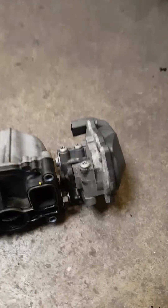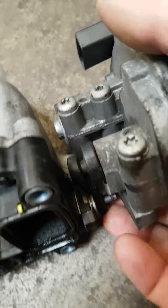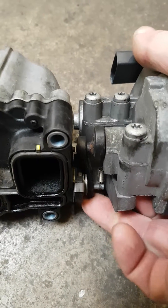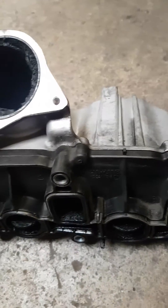First of all you've got to establish which one is causing the trouble. All I do is disconnect one and see if the fault code changes; if it doesn't, then the one you've got connected is the faulty one. The bit that causes the trouble is this little arm that moves the vanes backwards and forwards — it just moves the swirl flaps to change the direction of air going into the engine. As they wear you get movement on this spindle, it gets measured incorrectly, and then this flags up a fault code.